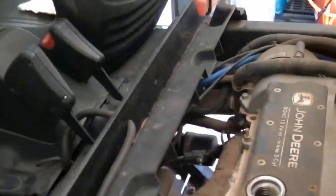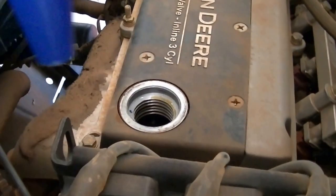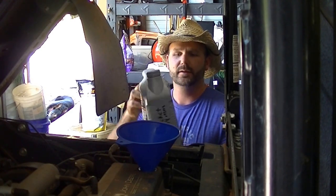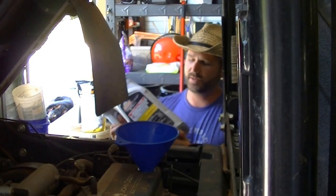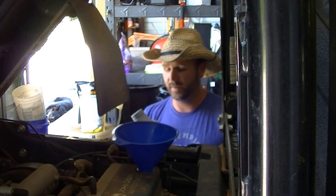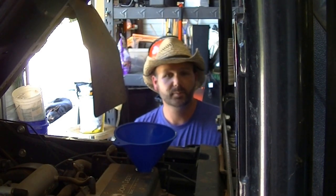Sometimes you're in a hurry and you're like, I can hit that hole with an oil can, I don't need a funnel. Go ahead, drop a funnel in there. Be smart — don't spill oil all over your engine. I've done it; if you've ever changed oil, you've done it too. Get yourself a funnel, get yourself some good oil changing tools, and take care of your equipment. Our owner's manual says 2.3 quarts for the Gator. I also have written on my jug that our drain socket is 14mm, so next time I'll know to get out a 14mm and that I take 2.3 quarts. I'm going to put two quarts and then a piece of a quart, start it up, let it run, check the oil, and add accordingly.